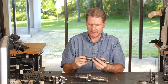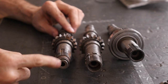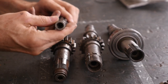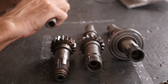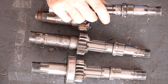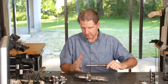The wet clutch came in in 1970, if I remember right. You can see it's got a seal here. The main shaft is hollow - you can see through it. It's got a hollow main shaft because you actuate the clutch from this side. There's a little worm gear that presses in and hardened steel rods that go and apply the clutch basket out here.